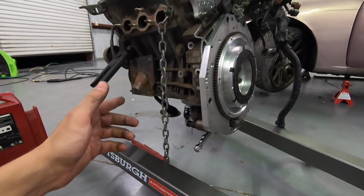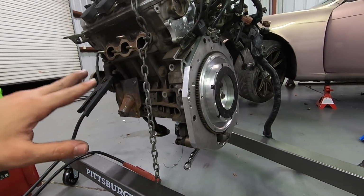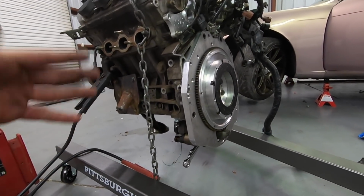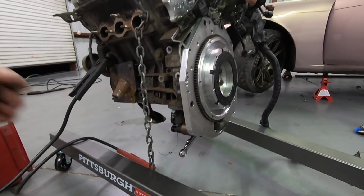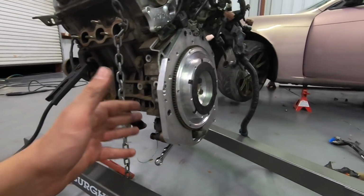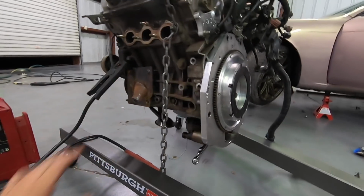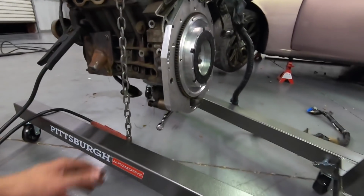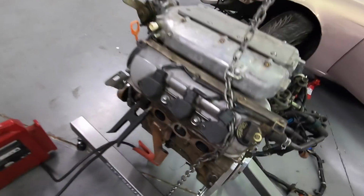Right now there is no oil pan on this thing, and I know that. It did have oil in the engine, so it's not like it's a brand new fresh build or anything. So right now there is oil on all of the bearings and everything inside. I'm not going to sit there and crank it forever. I'm just going to give it some blips, make sure that it is engaging properly and working before I put everything back in the car. So don't worry about there being no oil and everything. You know, it's literally dripping oil on the ground and I have to keep cleaning it up. So a couple blips ain't going to hurt the engine.